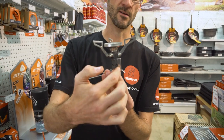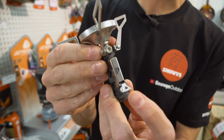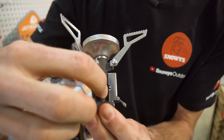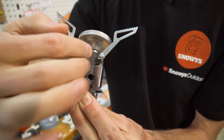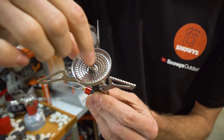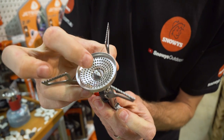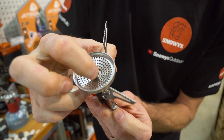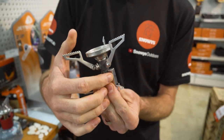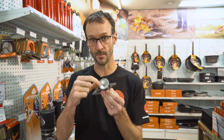One of the key features is the piezo igniter. This is a bit different from what we've seen on other stoves. There's a lever that lights the piezo, and they've routed the wire from the piezo up inside the body of the unit, so you can't catch it on anything and there's less chance of it breaking. The actual spark point is built right inside the burner head, so it can't catch on anything. On other stoves, the piezo can be the weakest point — it can get caught and break — but on this stove they've built it right in.